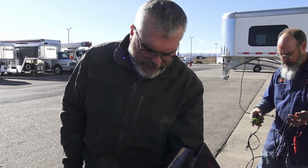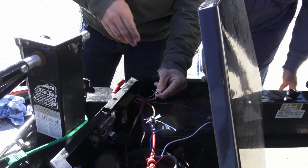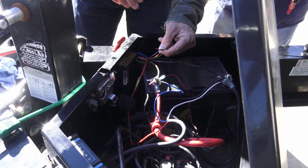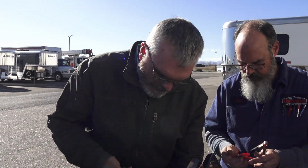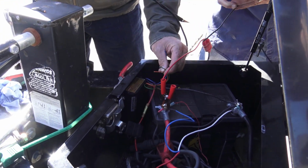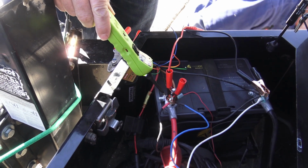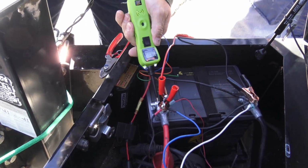This sets your charge profile. Oh, that's how you do that? That's how you set your charge profile, depending on which ones you want. How did we set the profile on this? I did it by not hooking these wires up. Oh, so it automatically goes to A, which is not having anything hooked up. Okay, cool. And then your lithium battery automatically controls voltage there. Well, it controls how much charge it will take. So leaving it on A basically lets it charge. There's 13.1, so it's charging. Cool. So let's do this.